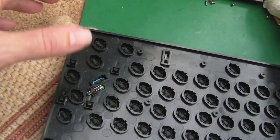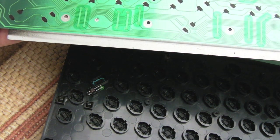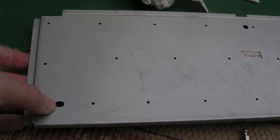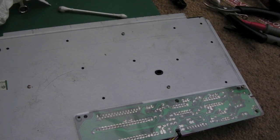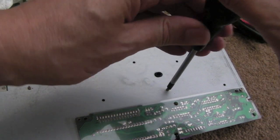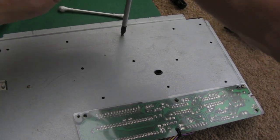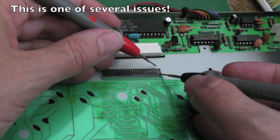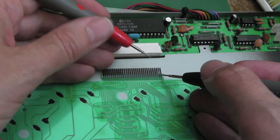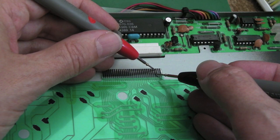I've collected up any bits of fluff - there's a bit there actually. Collecting up all the bits of fluff off that, it's pretty clean. Giving everywhere a wipe, put the LED back in here because it fell out, and wipe the contacts on that just gently. I'm going to reassemble it and give it a try - put several screws in and see what it's like before I commit to screwing it all back together. The membrane centred itself there - that's nice and straight. Getting the screws in... no, it's not working. So we must have a damaged connection somewhere. The CVB keys and the ones after them are not working. I'll show you - from the very edge to the end there's resistance. There's a little bit - there's a worn-off trace here. All the others are okay.